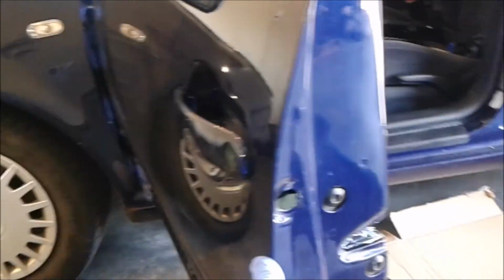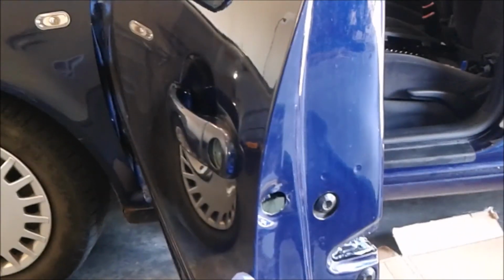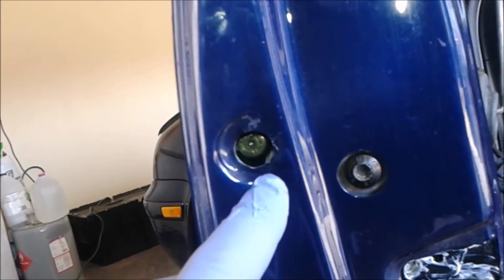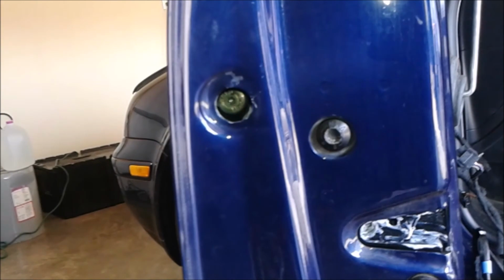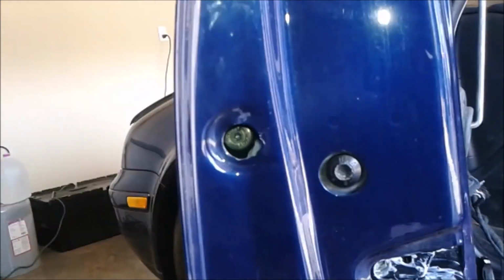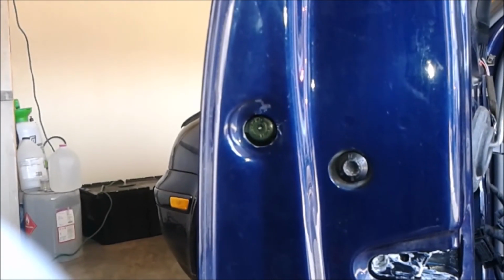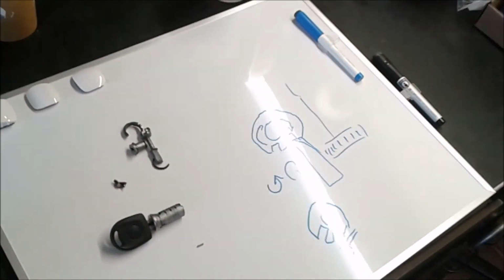That is a misnomer. That's one of the first things I had a problem with, because this T20 in fact does not hold the key cylinder in place. It commands the C-clip that holds the whole assembly in place. And let me show you. I made some crude, I guess you can call it, PowerPoint.